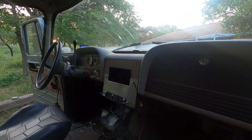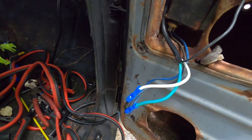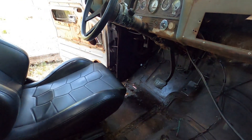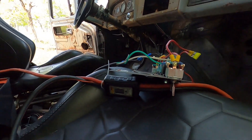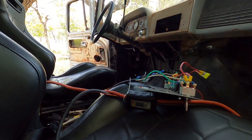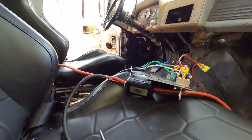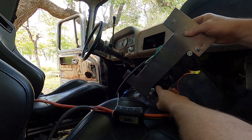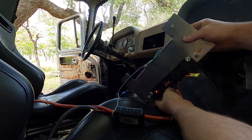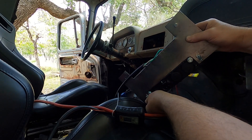I've got this thing all dummied up with the wiring: ground, positive, positive. Here's the back end of that panel, and I've done the same thing on the other side. Let me get a camera angle for you — we'll do the driver-side door first. You can see the panel: this turns on the power to the panel that way, it's all fused, and then here is up on the window and here is down on the window.